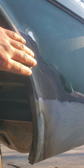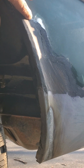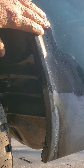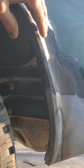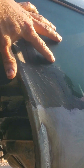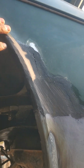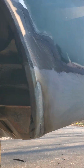I didn't want to grind too much because then I'm making the outer material too thin, right? And that's just going to lead us to problems. So I left it ugly. It's all internal, pitted, so it will be easy to fill it up with Bondo. And at least I'm not weakening the outer material from the original body panels. But yeah, it's rust free and it looks decent, or it has its original shape at least.